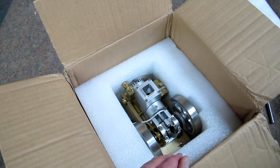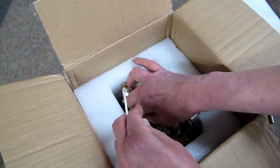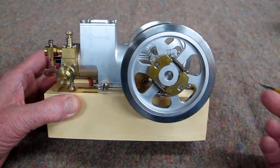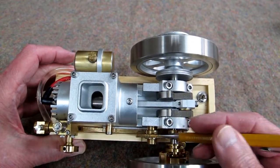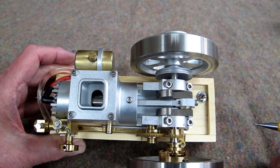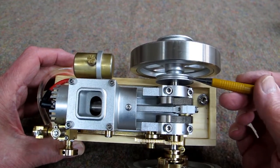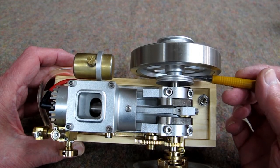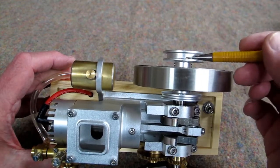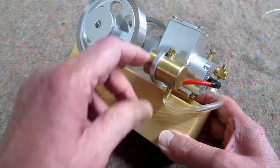Instructions, fuel tube, a pull starter. We're back to having a centrifugal governor on the flywheel. Two to one gearing like we've seen before. The hall effect sensor is here. The drive pulley. The magnet for the hall effect sensor is pressed in from this side. And we have a pulley over here for the rope starter. It still has the improved tank mount.